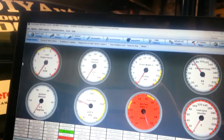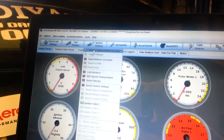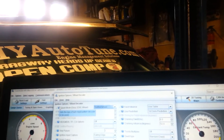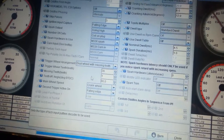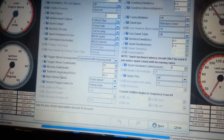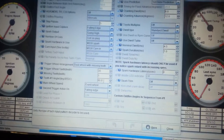So I got a thing here for the ignition settings, ignition option and decoder, wheel decoder. This particular one here has 36 minus 1 tooth. I have it set at 90 — number 1 tooth angle 90 right here — and that's the amount of degrees from TDC from where the crank sensor is.